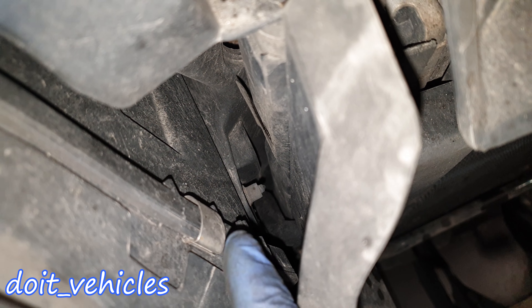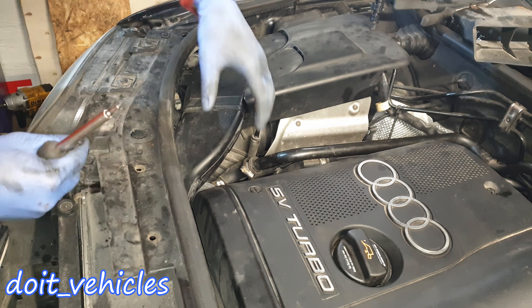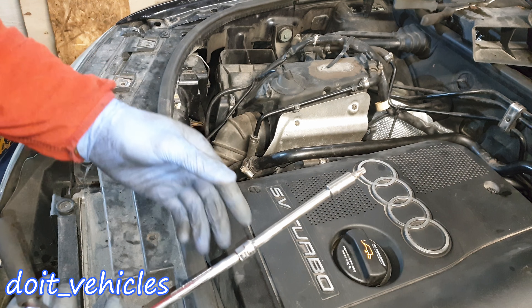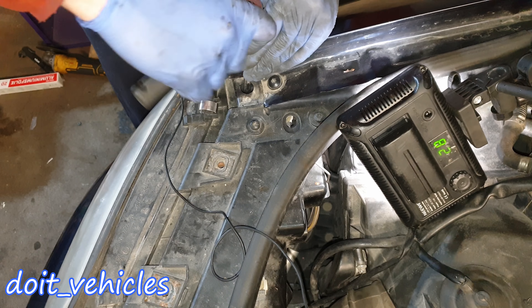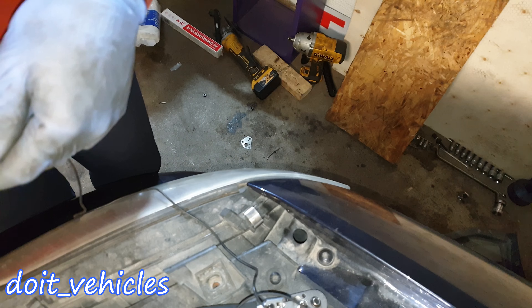In this video I want to show you how you can restore the headlights on this Audi A6. In most situations you can just polish the exterior of the lenses and see a difference. However on older cars the glass will also crack inside or the chrome around the glass will fade away, so you will need to take the headlight out and restore the chrome and polish the glass from the interior. To do that you will have to disconnect the headlight from 4 points.